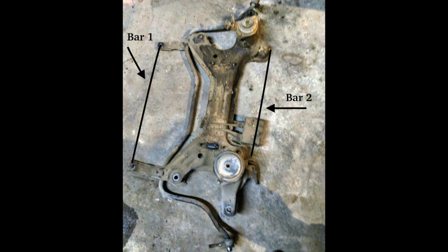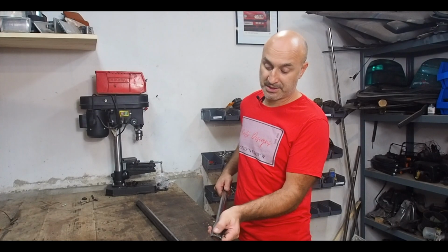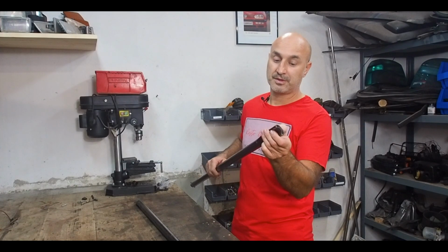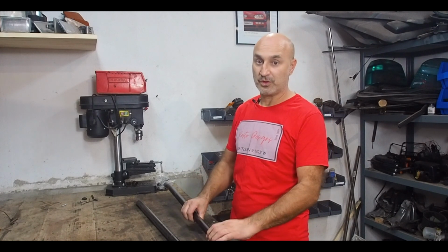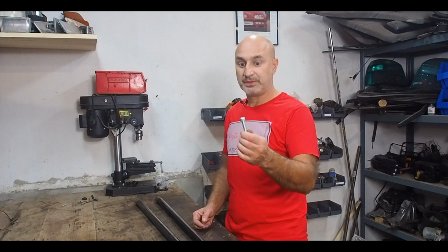The first thing I do is cut this off and then drill a 12 mil hole because the bolts are 12 mil. So these are the bolts that I use. I'll put these in the description, the length, the pitch, and what bolt to use if you wanna make your own. So we'll make bar one and then I'll show you what we do with the rest of the bar to make the front lower strut brace.